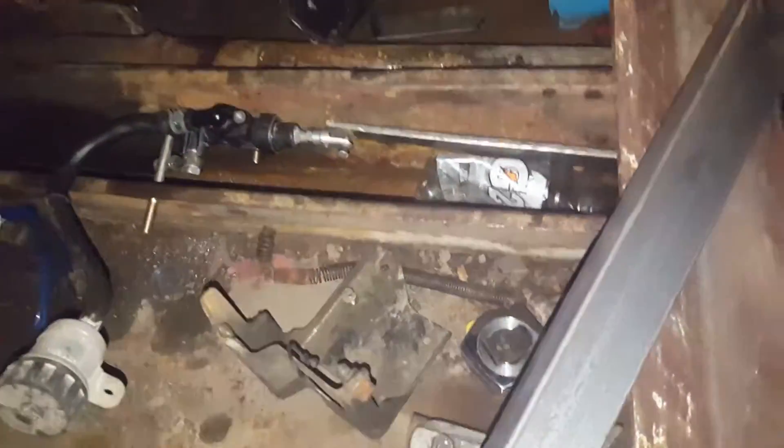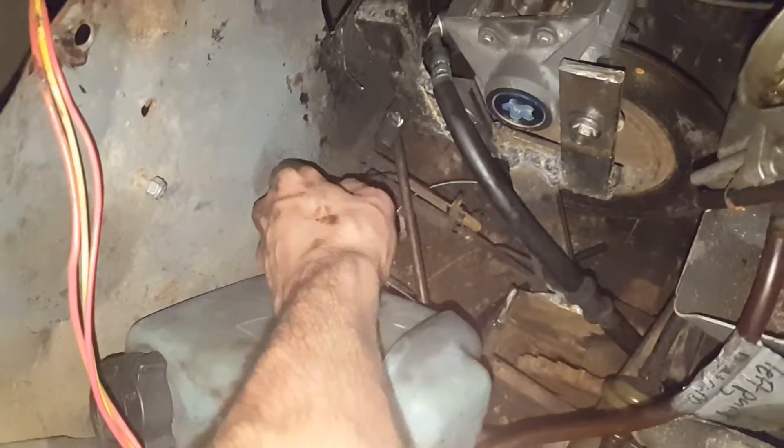I think drilling a bolt right underneath and having it rest on one of these bolts will be the easiest solution. After I get all the hardware bolted up, I have to bleed the brake line and then the brakes are good to go. Next I have to attach the throttle to the carb — that's a little easier since it's almost there already. Then I mount the seat, and I also have to mount the gas tank and oil tank. The gas tank goes in this area, the oil tank in that area, and then somehow the exhaust — it never ends.